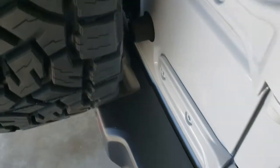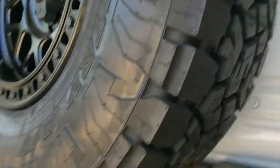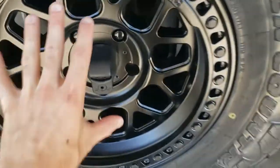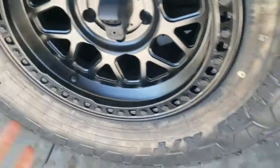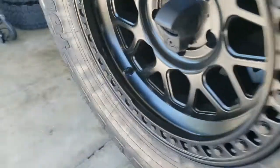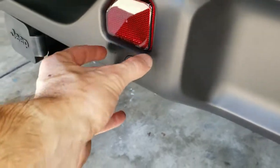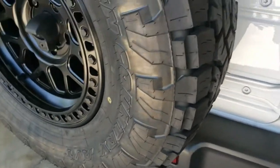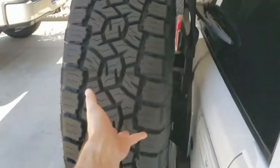You could have a bump stop extension and just be done with it, however I didn't want to do that for one main reason — the backup sensors have been beeping non-stop ever since I put this tire on. I've seen people say to take the tire off and rotate it so the valve stem is at the top or the tire weights are somewhere else, and it takes care of the problem inexplicably. Tried that, didn't work. Anytime you put this in reverse, the backup sensors seem to detect in a conical pattern and pick up the tire.